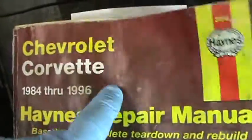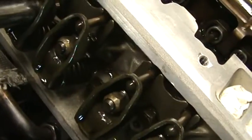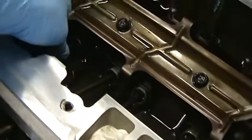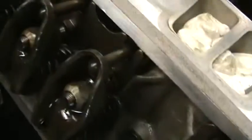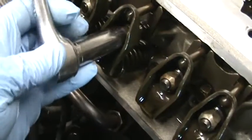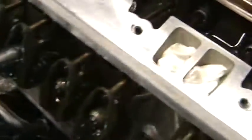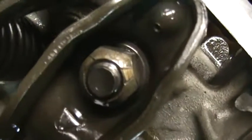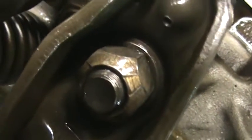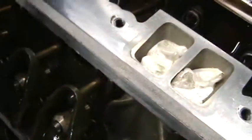Very simple, but I recommend you do it the way the book says. The other helpful hint when adjusting your valves — valve lash. If you sit there and push your socket all the way down while tightening it, you've got zero lash, which is false. That little cup that the bolt tightens onto — the socket hits it, which gives you a false reading.